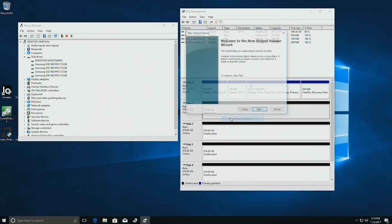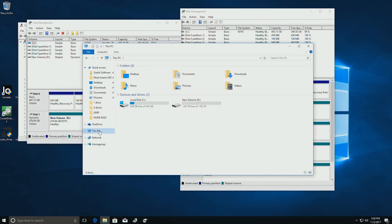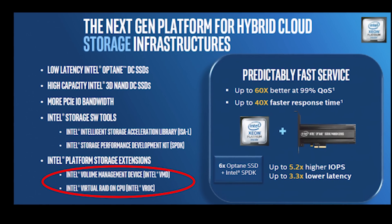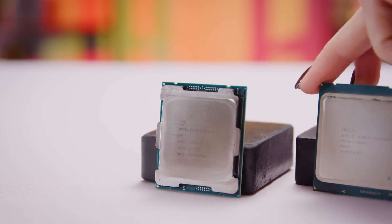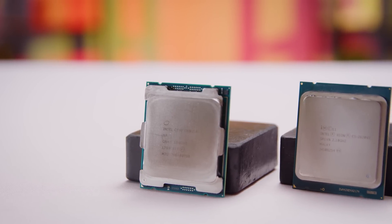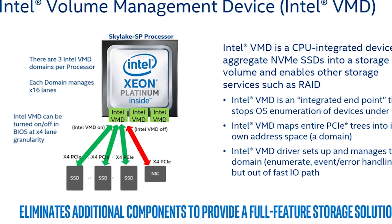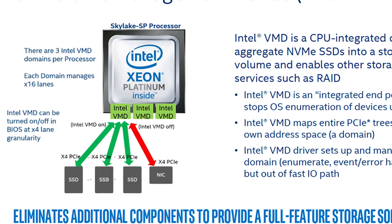But there's another problem: as cool as it is to run Windows software RAID for eye-watering sequential performance numbers, that has been done to death. We wanted to actually experience the speed in day-to-day use, which means booting Windows from our array. Let's talk about Intel's Virtual RAID on CPU, or VROC. Since the latest Skylake-X high-end desktop processors share much of their pedigree with server-level Xeon chips, they have three volume management devices built in, each of which can give up to four PCIe 4x devices direct CPU access for high-bandwidth, low-latency performance.